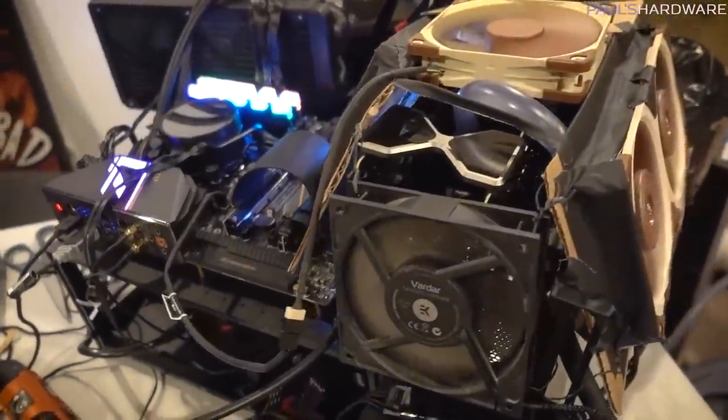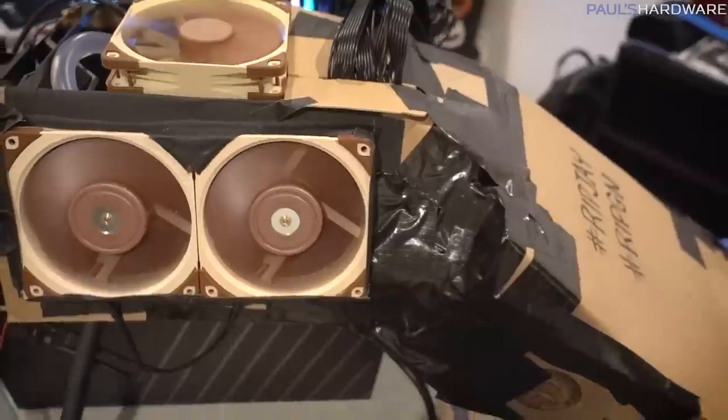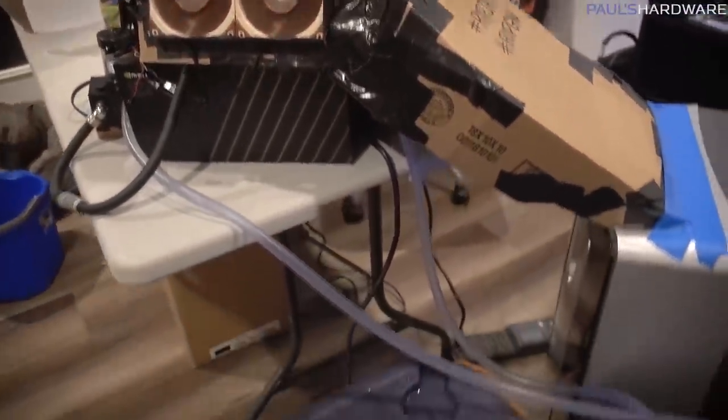So I think my airflow tunnel that I set up down here with all the fans on it and everything was fairly effective, although I still wasn't able to get the memory past about plus 550 for the memory overclocking. So it does seem like there's some headroom there for overclockers who are going to get full blocks going on there, or other solutions like, of course, LN2.